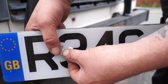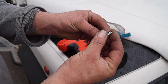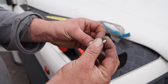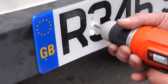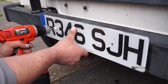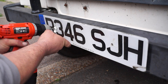So we're going to do the white one. Selecting a drill for a self-tapper can be a bit tricky, but I usually say that two thirds the size of the self-tapper will be sufficient for the screw to make a thread and not get jammed. So I'm going to drill myself a hole in this bumper, then wind in the screw like so — easy job. Just to stop yourself getting in a mess and screwing up the screw head and not being able to get the screw into the hole, like I'm having problems here.